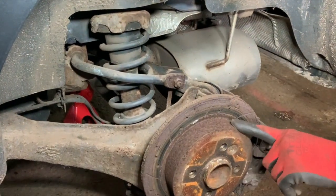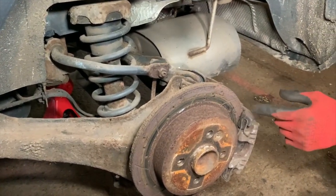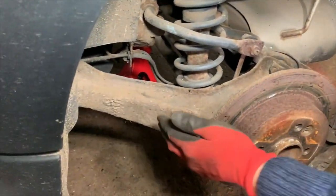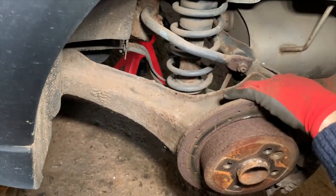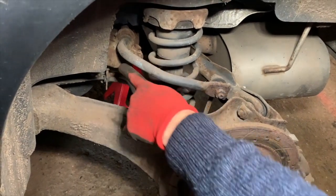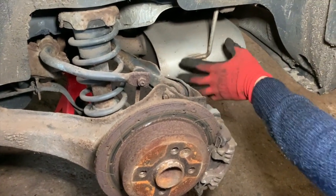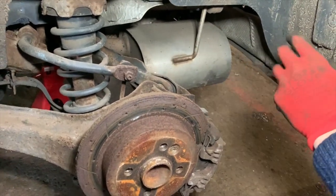Come in and have a closer look — you can probably see already these discs have pretty much started to rot away. I only replaced these about six years ago but you can see with all the salt they've really corroded away. You can see the uneven pad wear — the pads start to change shape — and the disc sensor has already triggered. We showed you the aluminium trailing arm; this is the steel one and as you can see it's really starting to rot. The sway bar's not too bad, but up into the subframe you can start to see where the salt is starting to attack it. The control arms aren't too bad — a little bit further back.